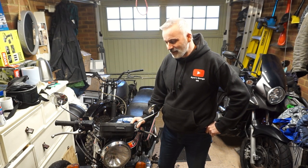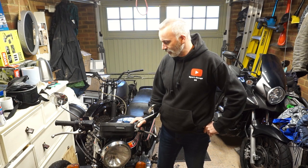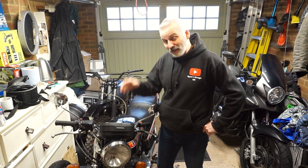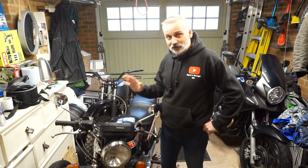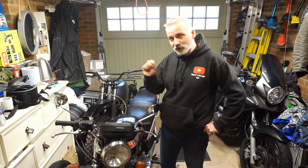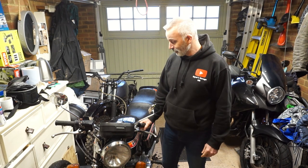Yes, I was letting it get warm, but I was probably giving it 5 minutes. Multiple of you have said that until it's genuinely up to temperature, trying to balance the carbs and sort the mixtures out is not going to work properly. So maybe not right now, and maybe not even on camera, but I'm going to try it again, get it properly up to temperature, and then try adjusting and balancing the carbs again and see if that makes a difference. Because it's definitely improving, but it's still not where it should be just yet. But your help, thank you. Right, let's get this moved.